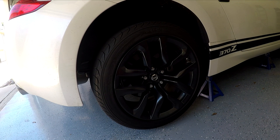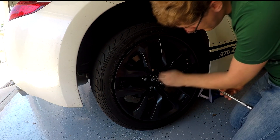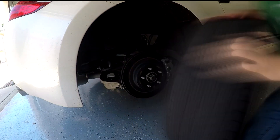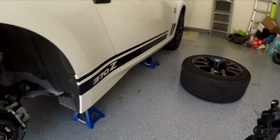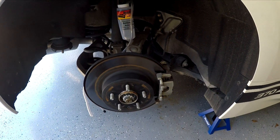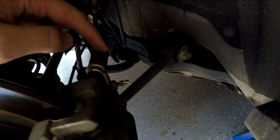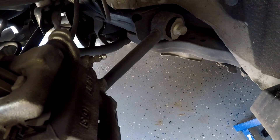Now that we've got that motive bleeder pressurized and ready to go, it's time to start taking off the wheels. I don't know that there is a necessary order, but I've heard that usually you'll do the wheel farthest from the brake reservoir first and then proceed from there. So we'll go ahead and start with the back right one. There's the wheel removed. I have the base model, so that means I've got the single cylinder caliper on the back. If you've got the sports package, yours might look a little different — I believe they have different brakes. Comment below if I'm wrong.